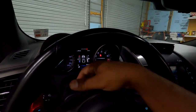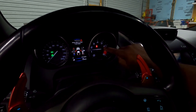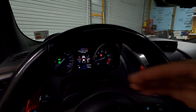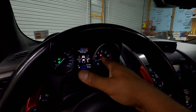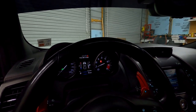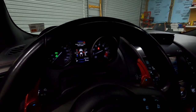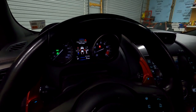All of that was in this harness. And the seatbelt light had been intermittent. I had already put it on my maintenance list to go get it checked out at the dealer. But all of that was coming from that harness slowly breaking. The seatbelt light was just the first one of all the issues that was happening. And slowly it was the hang up call, and then the volume and channel change buttons started going out next. So slowly and surely, I mean, almost everything was going out.